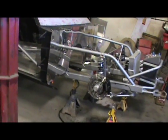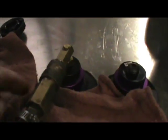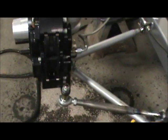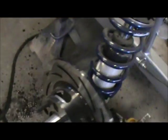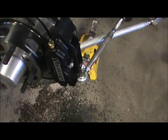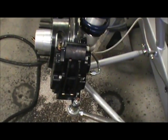I've got the car up on stands and I'm bleeding the brakes. I have a pressure bleeder — it's a pot full of brake fluid and it has adapters for different master cylinders. I need to plug the hose into the master cylinder and pressurize the system. Because these are four-piston calipers with four bleeders, the caliper was mounted on the back and I'd bled the top two pistons. So I unbolted it and flipped it around, because you want the bleeders at the top when you're bleeding. I flipped it so now I've got the bottom bleeders up on top.